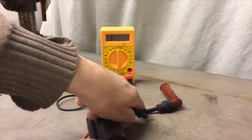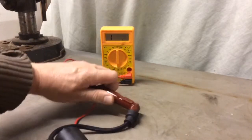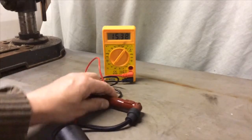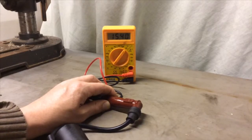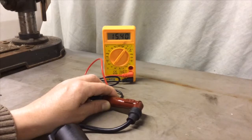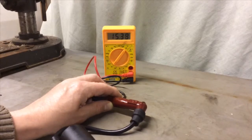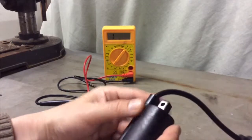Now let's try the secondary. That should come in at around 12 to 14.5 thousand ohms. There you go — that's showing a resistance of about 15.5 thousand ohms. So that's higher resistance than the system should have, which is actually quite a significant reading and could have something to do with that dodgy lead.